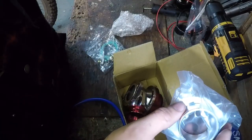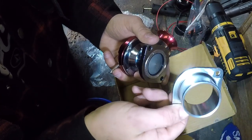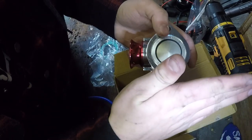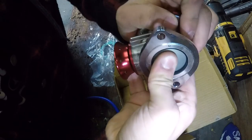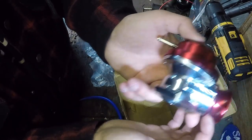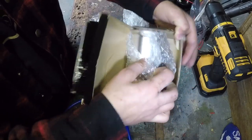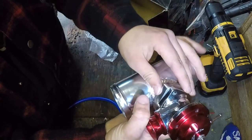And then in this little bag, we've got this aluminum piece — I'm not really exactly sure how this works, if anyone knows please comment down below. This is the actual blow-off valve. You can adjust for soft or hard blow-off. It's pretty simple. When you close the throttle plate, if you don't have one of these, the air would go back through the turbine. But if you do have one, it would push this valve in and exit through here. This little amplifier trumpet kind of thing — it's got holes in it just to give it a nice whoosh sound. And in the other half of the box, we have the coupler with the flange welded right on.